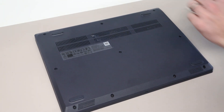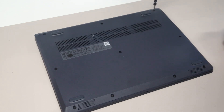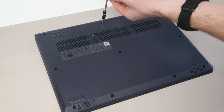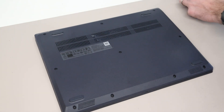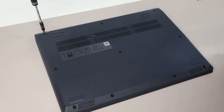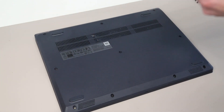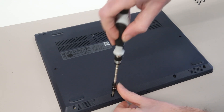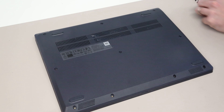To start off, we are going to remove the screws from the base of the laptop. I'm going to place them off to the side in the same positions that I remove them from. Generally on the Lenovos these are all the same size anyway, but if any are different, this just makes it a little bit easier when reassembling. And actually these front four are shorter, which makes sense because it tapers in here at the front.